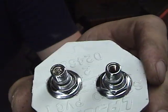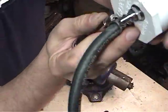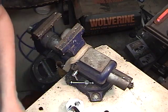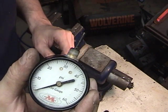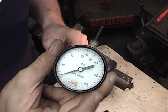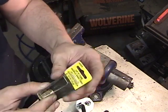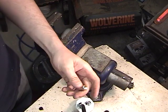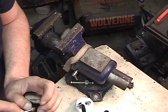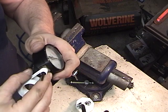Take this quarter-inch fuel line and cram it down on here. You want to put the clamp on at the small part — notice that flange is two different diameters. Clamp that down good and tight so it doesn't budge. Now the one thing that's unique about the pressure tester I build: I put the gauge on it so you can watch the pressure and how it's behaving in your intake. When you stop applying pressure, how fast the needle drops is a good indicator of how healthy the system is. Take the quarter-inch NPT coupler — a pretty standard part you can get at the auto parts store — but we want to use Teflon tape to make sure it makes an airtight seal, since the threads aren't exactly perfect for this.